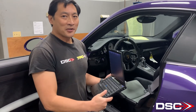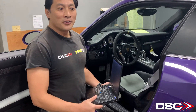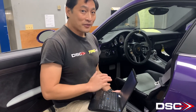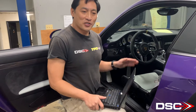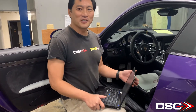I have my laptop here ready to zero the ride height sensors. But the first thing we need to do is make sure the car has been driven after the FAL has been in the down position, because we don't want to zero the ride height sensor when it's still hung up by two or three millimeters — that defeats the purpose of this whole exercise.